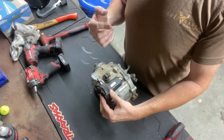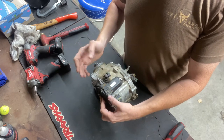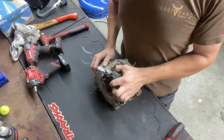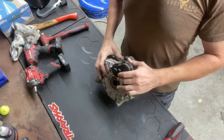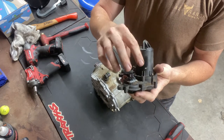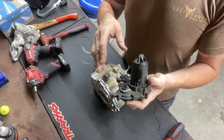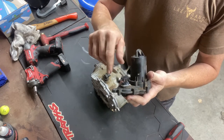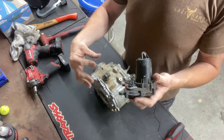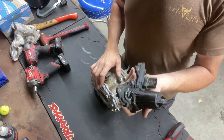When I take a diff out, I normally always take this actuator off before I even try to get it out of the frame. You have a T30 here and some T30s across the bottom actuator. If four-drive is off, it's kicked back to where it needs to be. If it's on, that's what's rotating it, and the computer and the drive system are telling it to give it more, which gives more clutch and makes it lock up more. I'll show you that here in a second, so I take that off while I'm taking it out of the frame.